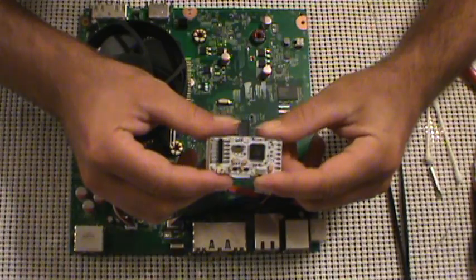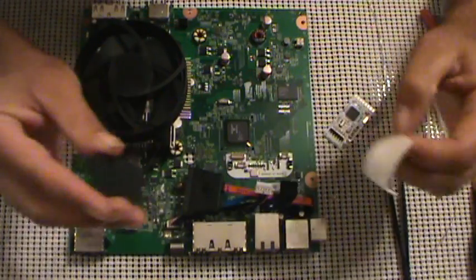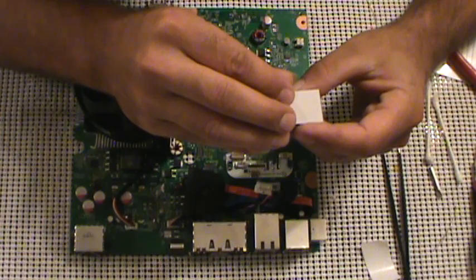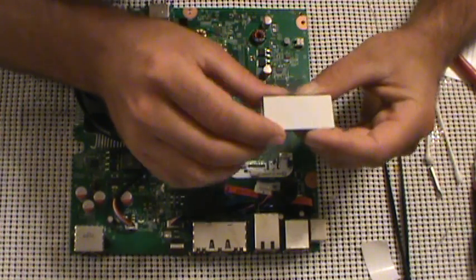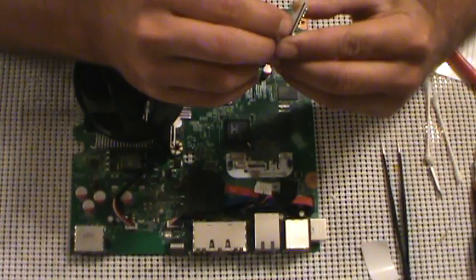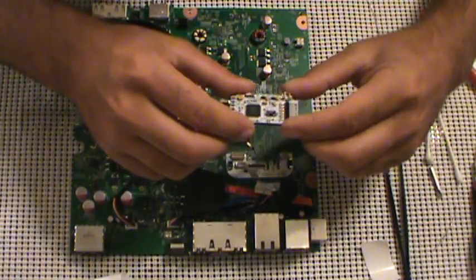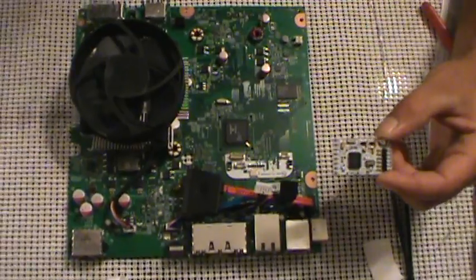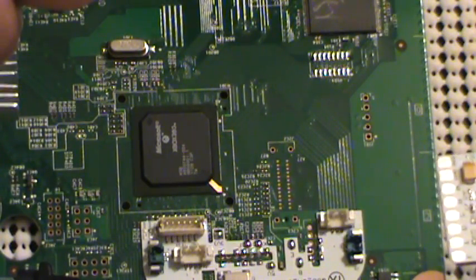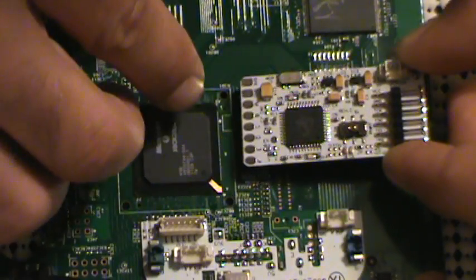For the moment we're going to get our CoolRunner installed. Now at this point I have not programmed the CoolRunner as of yet. Generally I like to hook it up and program it before installing it, but for the sake of this video I'm going to install it and then program it. I'll cover the steps — it's real simple, just switch to program after installed when you go to hook it up. For the Corona, everything is a bit different; the CoolRunner is going to be installed on the top side of the motherboard for this install.